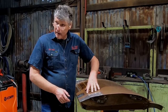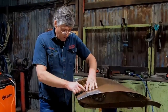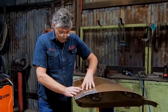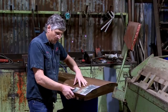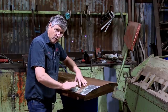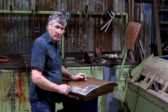What we can do is work this area in here. We're a bit low in the door to comfortably get my hand in there, but if we support this line here with the dolly, we can hammer this edge and that's going to want to pull the metal through this area and lift it even more. What I'm suggesting is if we just get the back of the hammer and work this area here to knock down the high spots, then turn over and work on the face of the hammer, we can actually get that quite nice and very close to the original.